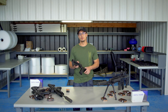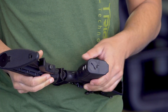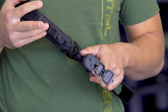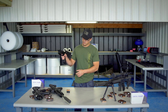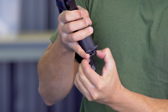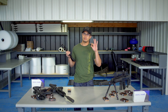To remove the battery, take a quarter, or a nickel, or whatever you have on you, and turn the twist latch. Then open the battery door. You don't want to start digging in there with a knife or something like that — you can damage stuff. The easiest way is to just shake the grip a little bit, and the battery will actually fall to the floor. Then pull it out a little bit, and instead of trying to rip it out, you just pull back on it, and that will release the battery strap from the battery, and then your battery comes right out.